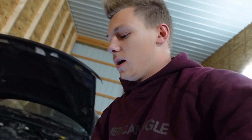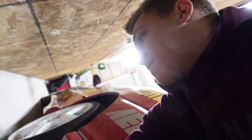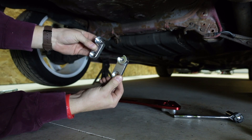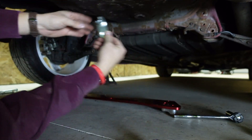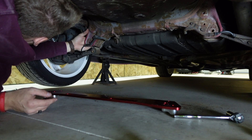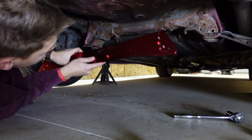You'll have to screw on these brackets under the back — they just have two Phillips screws on both sides — and then you'll also need these other brackets, which I'll show you where they go once we get back into the car. First thing you need to do is take these brackets; notice how they're indented here — that's because they go on the inside with a bolt that's there. You'll take this behind here and line it up where it will sit on top of the holes that are currently there.